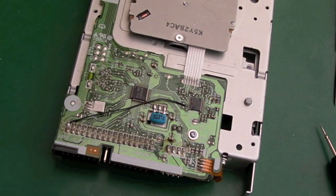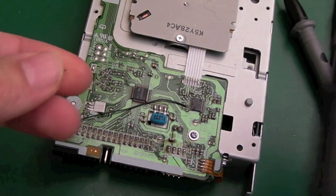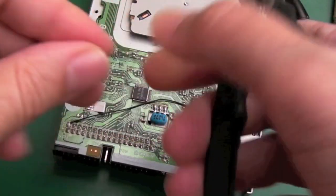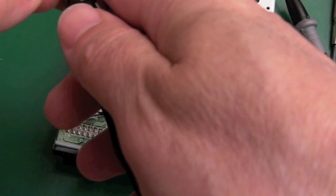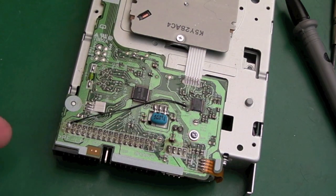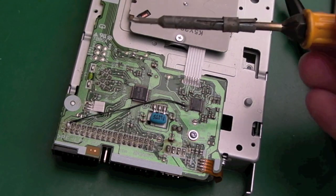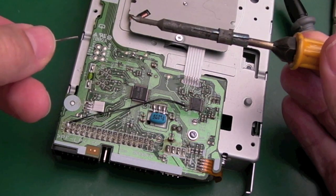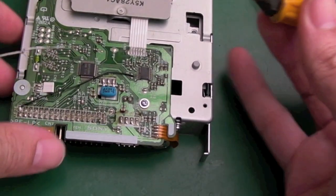Yeah, so the reason the disc change doesn't work is another wire is required, and I found this from another location actually. I might stick a link to the video below. It's doing exactly the same as what I'm doing here, but the difference, I guess, is that I've shown, well, I think so, at the start of this video, that you can use this drive with the ST as well. But that's no surprise, because all 720k drives for the PC tend to work with the ST.